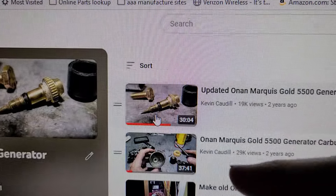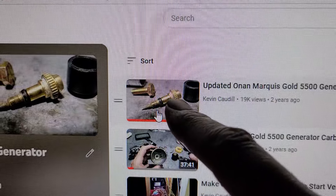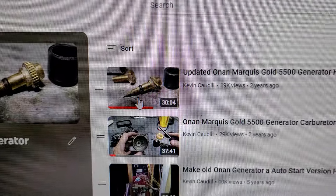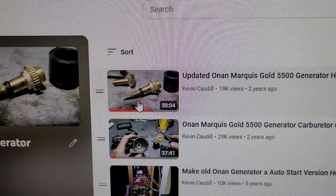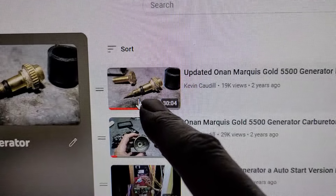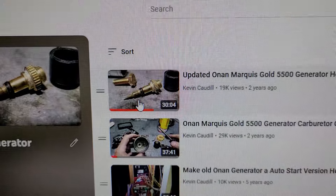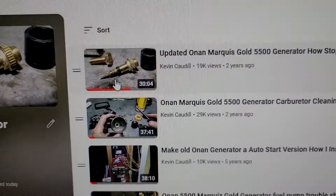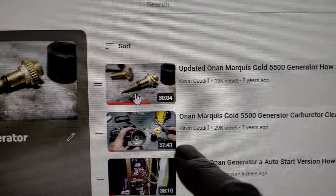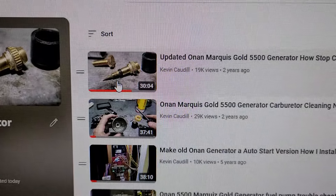On the main jet there's a black knob — an altitude knob — that only gives you about a quarter turn. But hidden behind it is the main jet for the carburetor, just like old lawnmowers before EPA got involved. If you remove that little black cap it gives you access to the screw. You can give it a full turn and sometimes that'll take the surging away. If not, I have a separate thorough cleaning video where I disassemble the carb completely and go through cleaning every orifice and jet.